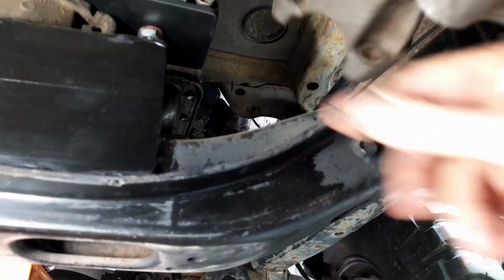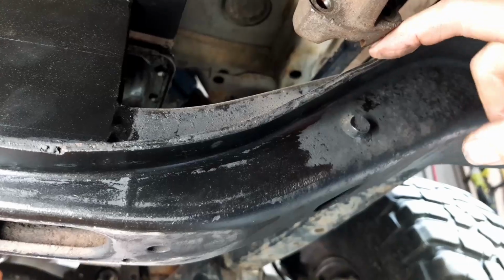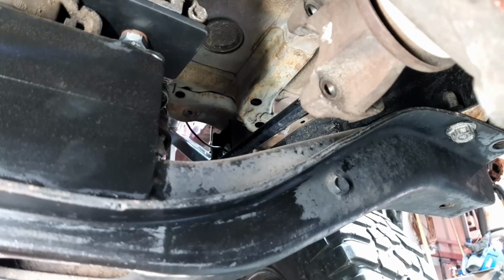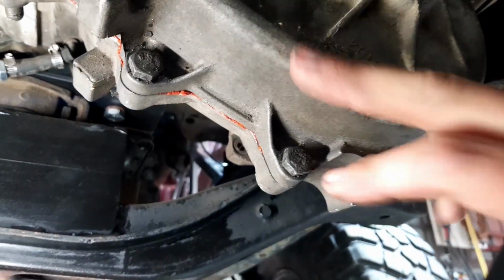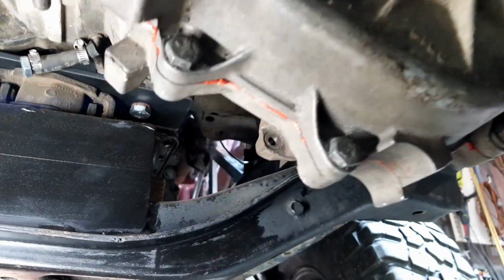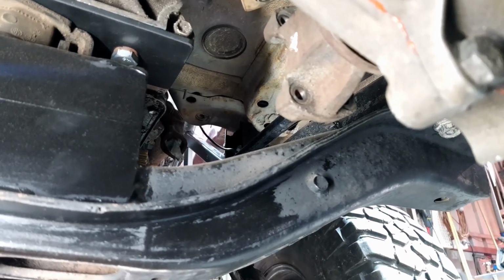Now it turns nicely as it's supposed to, but when I hook up the drive shaft, we got a bit of a clearance issue, and I didn't think about that because I had to drop the leg of this transfer case from the other side in a previous video. Link in the description for that. But the cross member's in the way. I can't put the drive shaft in all the way up under there.